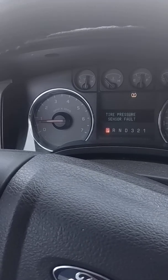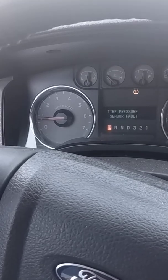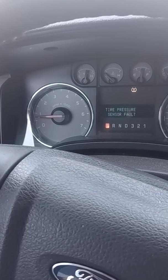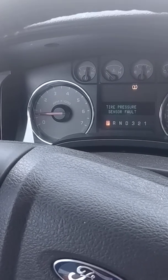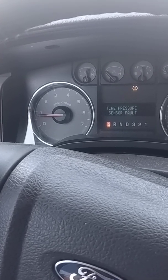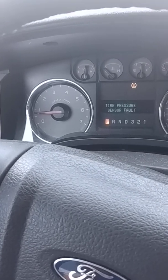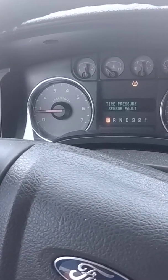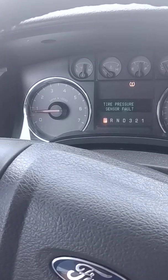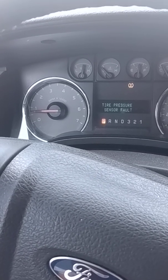So I'm kind of ruling those out. The only other possibilities I think in my brain are the fuel injectors, or a coolant temp sensor, this fuel pressure regulator sensor, or the purge valve canister, or one last thing is the fuel tank pump and sender unit. That's pretty much it, I can't think of anything else that would cause this.